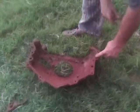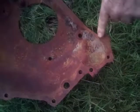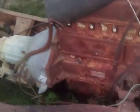And if you wanted to, you can saw off this bottom part of this bell housing. This one's broken right there at that bottom bolt. You can saw that off and use a 2-bolt starter that comes from up underneath, like the automatics had. I prefer the 3-bolt ones myself. But that's Powerglide.